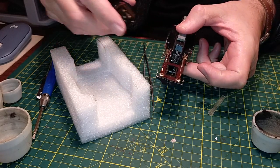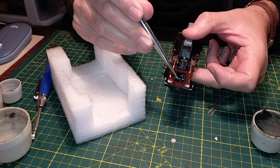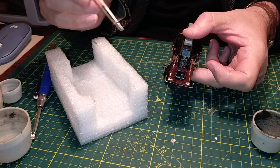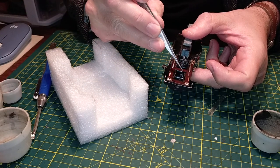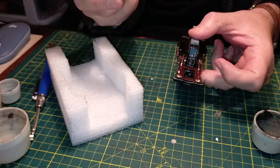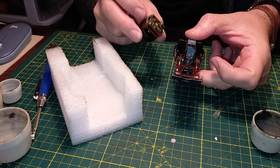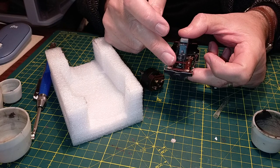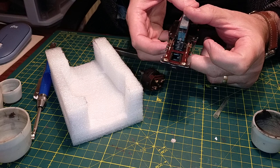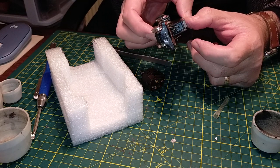Because in the BR75 there was a small plastic plate under here, which was a bit of a fiddle to put back in. And there was a little strip of brown insulating paper which was separating the metal motor bell housing from the chassis. In this case, we don't have it - it's not here. So we don't need to worry about that. That's one thing less to worry about - it's easier and simpler.